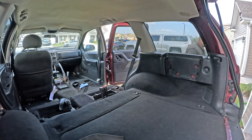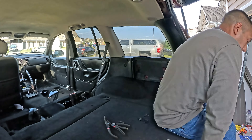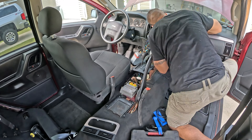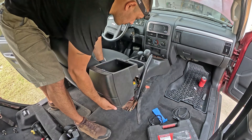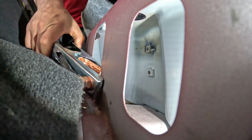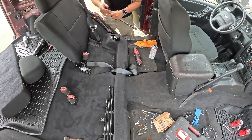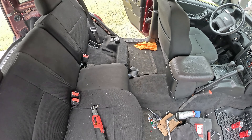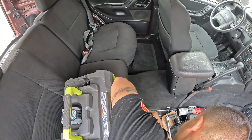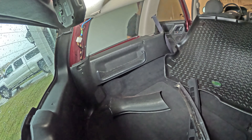At about two weeks out from delivery, most of the exterior was complete, so I began finishing up the last interior details — including reinstalling the cargo area trim, reinstalling the shifter which I did an epoxy and zip tie repair on, adding USB input to the head unit and running it to the glove box, reinstalling the center console, and then finally getting in the seats. Before installing the rear seat I had to fix a damaged nut on the back side — it was a really tight area so I did a bad job, but I got the nut tacked in and was able to install the rear seats. The seats got surprisingly hairy during reassembly and my dog kept sitting on them, so I did a quick vacuum and then installed the front seat before finally installing the last of the interior trim in the cargo area.